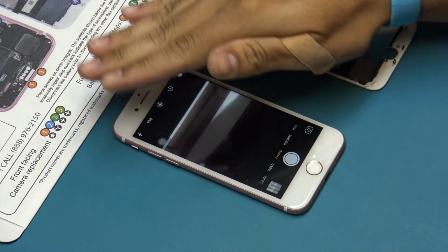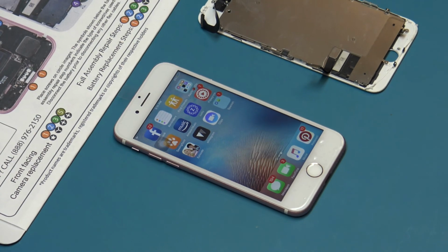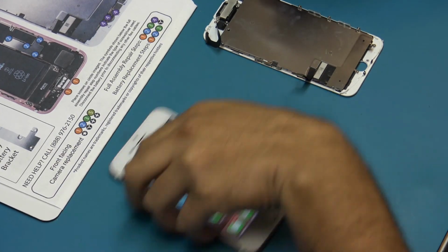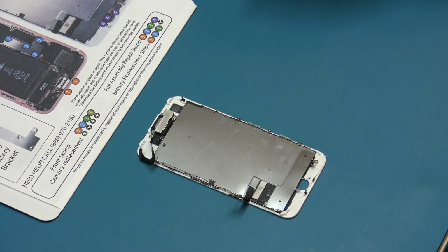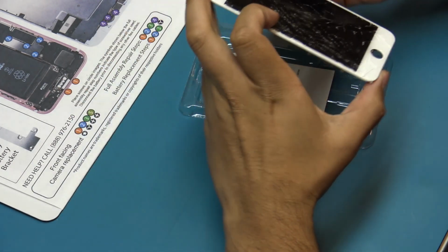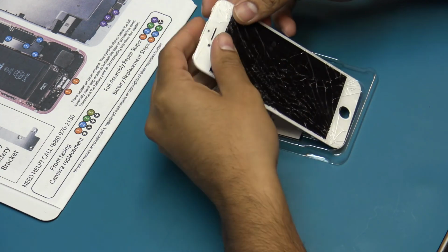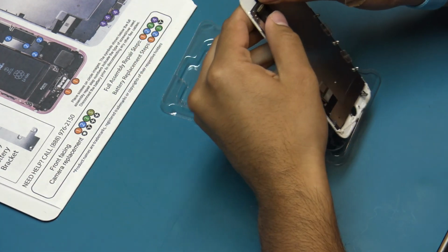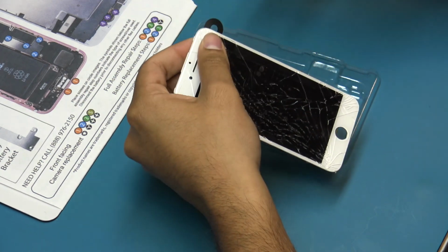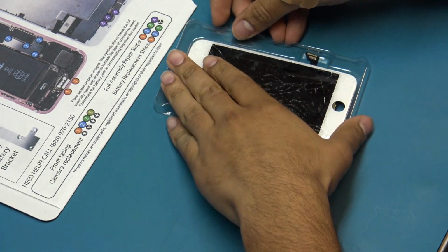Inspect your repair mat for any remaining parts or pieces. Remember to place the end user screen from this repair into the packing of the new display assembly used. Mark the box labeled End User to indicate as a screen for recycle.